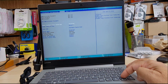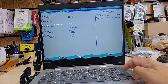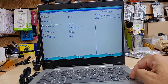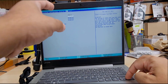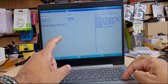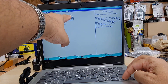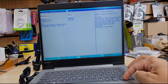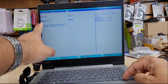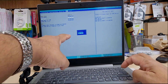This is exactly the same one, as I've said. So once you make it enabled, the system is ready to either install Windows 10 in UEFI by enabling secure boot, or Windows 11, regardless. And if you go to the boot tab, you can see the boot mode is only UEFI. The UEFI setup wouldn't work if you leave the secure boot off, so both have a relation — both of them have to be enabled at the same time. There is one last option: USB boot has to be enabled if it is disabled. Remember.